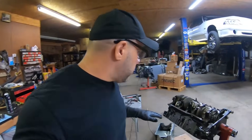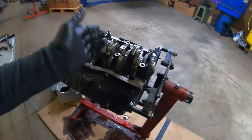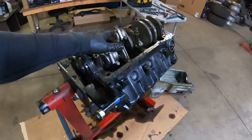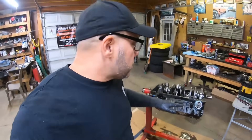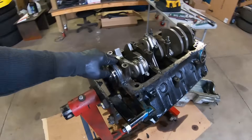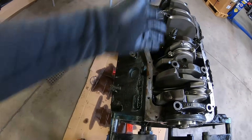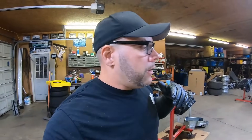We're pretty much at the point now where we're going to start tearing the rest of the motor apart - popping some of these pistons out and rod bearings. We'll take those out, then take an inspection at our main caps. I always stress zero balance, and you can see some of the things that have to happen - you've got to add Mallory and change a lot of stuff up to make zero balance actually work. But this is honestly one of the best things I can show here on the channel: zero balance your motor if you have the option. It's going to make worlds of difference in harmonics, especially when you're pushing it with horsepower and RPM. If it's affordable, make it happen.